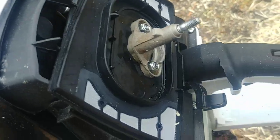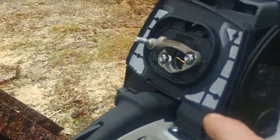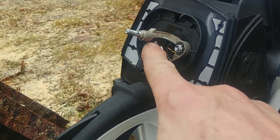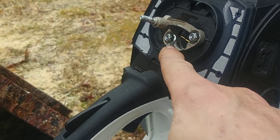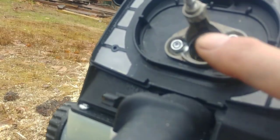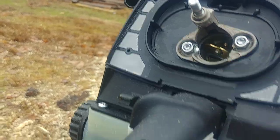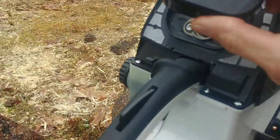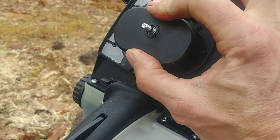You can see that's all pretty dry. Oh, you can see that I modify the intake horns too. I don't know if, you know, I go through mine all the way, but as you can see on the intake horn here, I actually take out the little separator. There's a rod that's right here. I cut that out, and then I kind of port it out and polish all the inside and make a smooth transition on that too. And does it make a difference? I don't know. It's just sitting there, and it's not very hard metal, so why not do it?